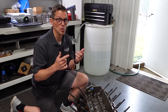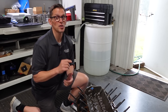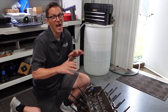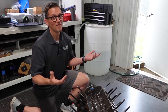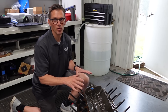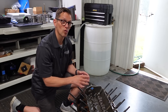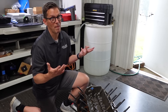That way we can actually reuse the other pistons, replace the one piston that's been scuffed. Then what we're going to do is use line-to-line skirt coating on all the pistons to bring back our piston-to-wall clearance. That way we're saving the money of not having to buy new pistons, not having to wait as long because hopefully they can get one done faster than they can get eight done.